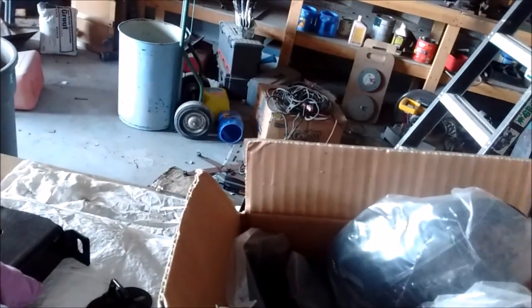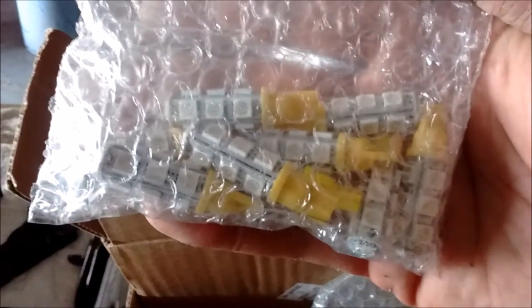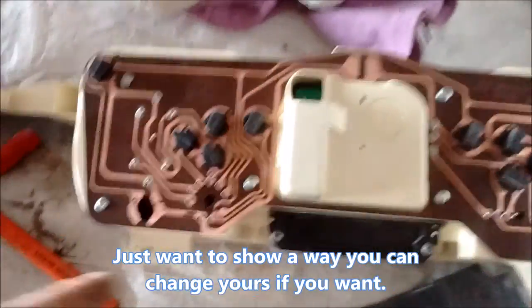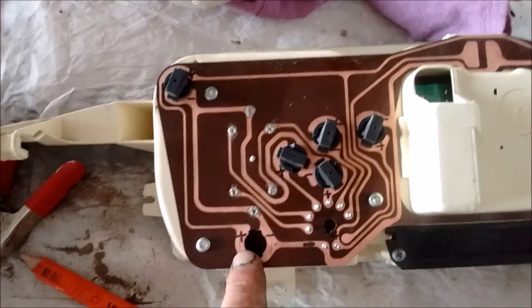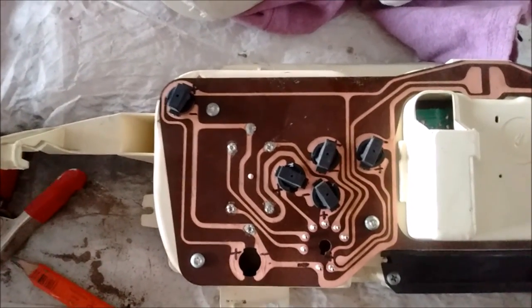I've got UV, blue, all different colors, white, and yellow ones that just plug in — I'm using those on my clearance lights and marker lights. Little white ones for license plate lights and stuff like that. Anyway, I'm getting ready to put these UV lights in the cluster. I'm going to take a piece of 600-grit sandpaper, sand a little bit, and then solder the ground and solder the resistor to the positive side.